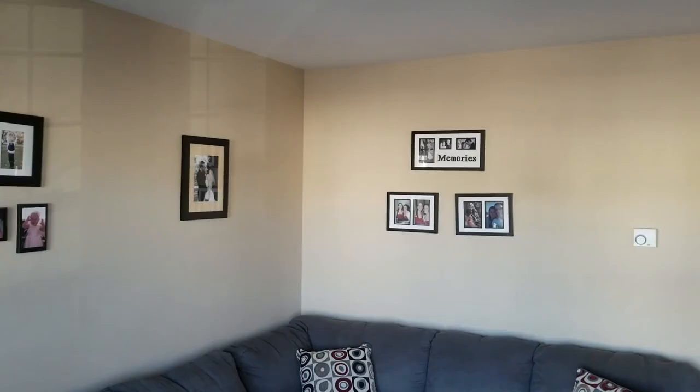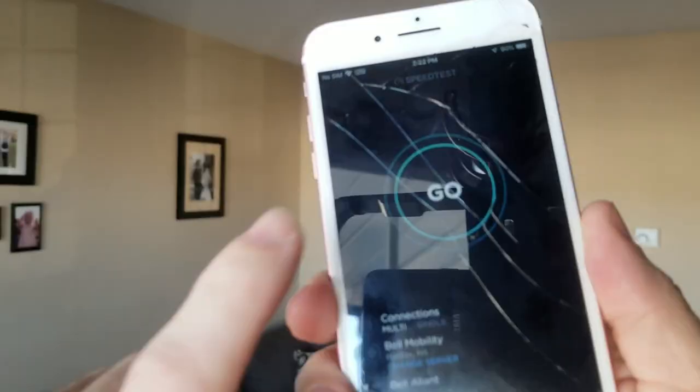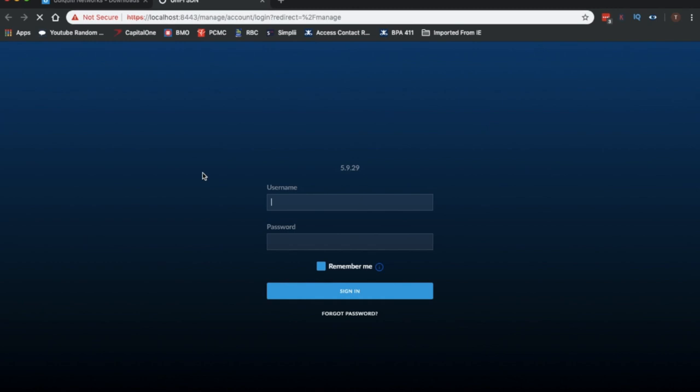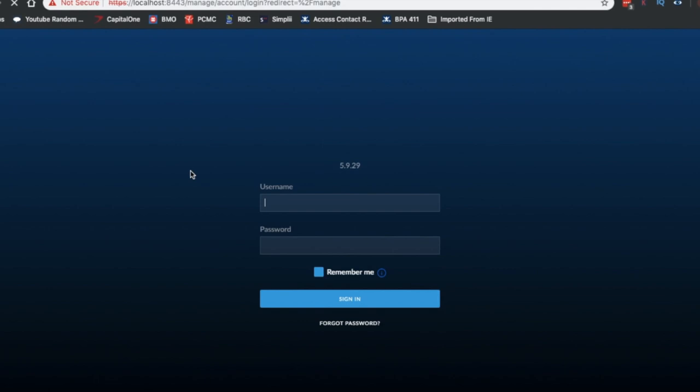Let's test it together to see what we get. The reason this works is because the access point my provider installed is in the corner of the house and this one is more central. As you can see, it fixed the problem. Follow the step-by-step instructions to set up the program. If you have trouble, look it up on YouTube — there are lots of videos on how to do this. I only had one small issue: I was not on the same network as the access point, so make sure you go onto the same network. If you have an Ethernet port in your computer, that's best; if not, use an old router or other wireless access point on the same network.